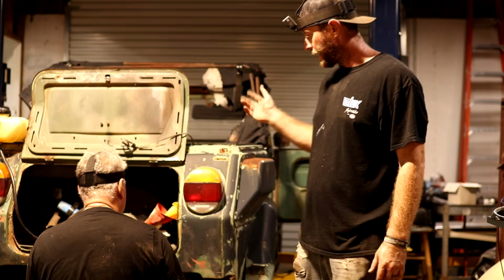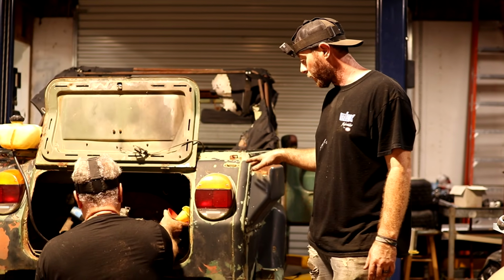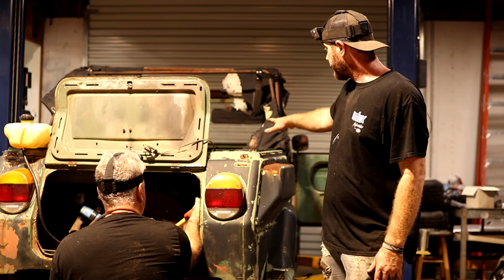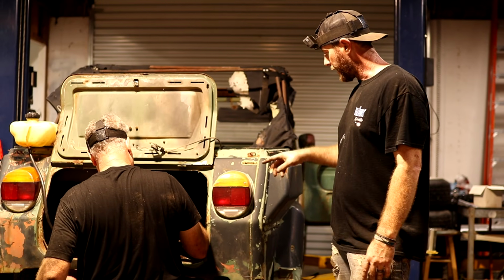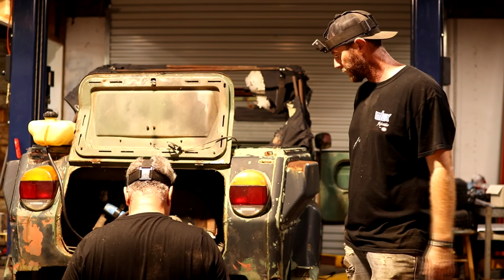So, as I stated, we just went with the starter that was on this car, so we're not sure what kind of shape it is. We don't have a key to this, so we're going to have to pull the steering wheel apart to get the tumbler out to put a new ignition switch in it. So for right now, we just got a couple wires ran to the starter where we can kind of jump it across like we were doing on the Super Beetle.